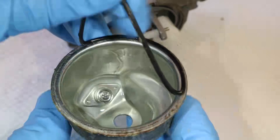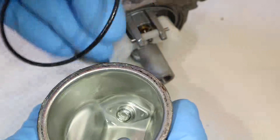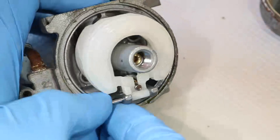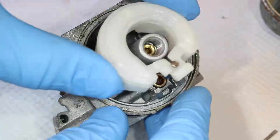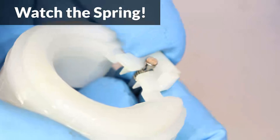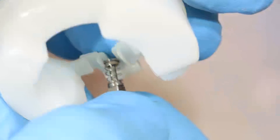It's a good idea to order a new o-ring ahead if you can. I didn't think it was going to be this bad, so I'm going to have to reuse this one. Now remove the float hinge pin and pull the float up, being careful that the needle doesn't fall out. If you need to remove the needle, just slide it out, but be careful because the spring will pop right off. To put it back in, put the spring on first, slide it back on the float, and make sure that the spring is working properly.